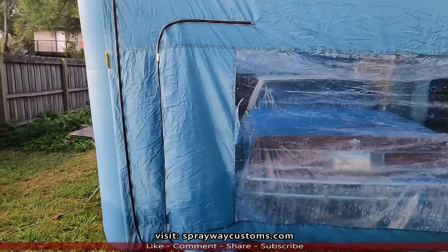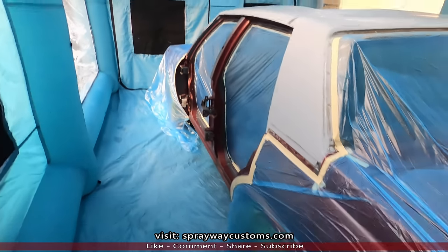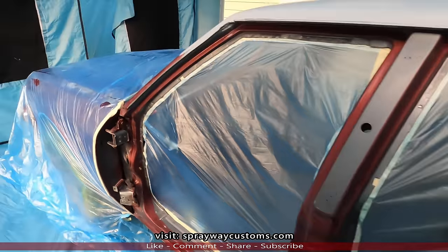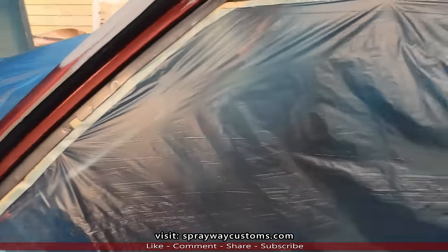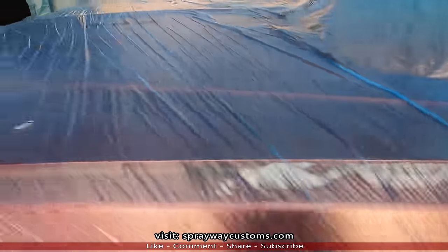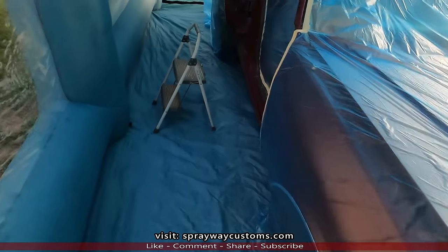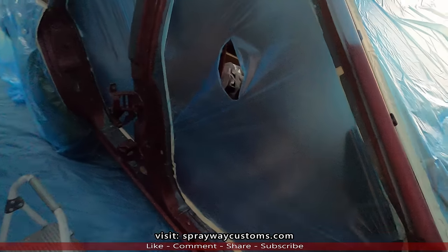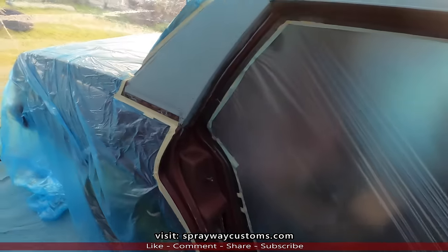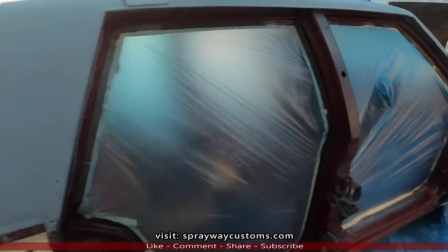Okay, let's go inside so I can show you the mask. I had wiped it down yesterday also. Make sure my tape is still laying down good. Let's get ready to go ahead and spray this sealer.